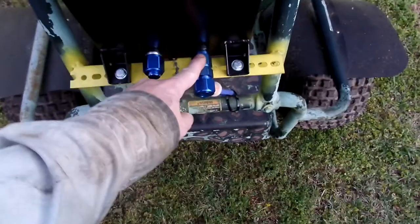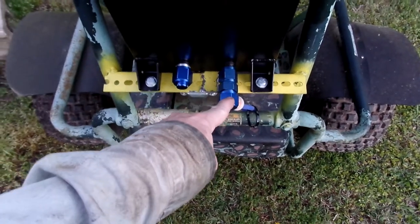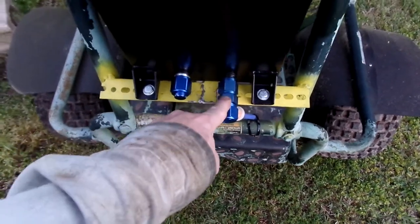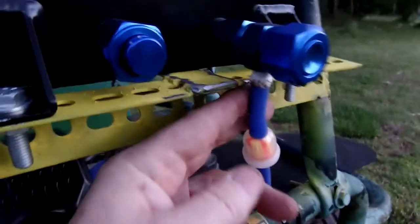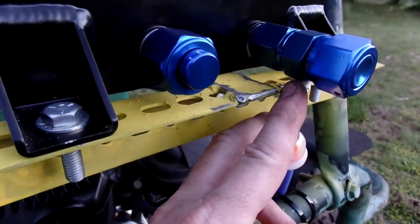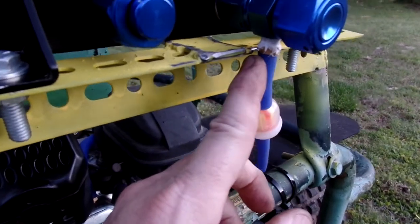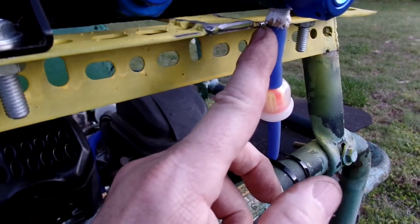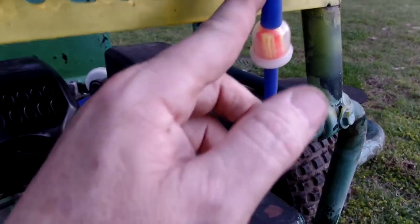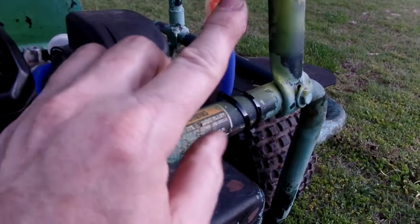This cap is not used. This is a dash-10 and a dash-10 end cap, and this is tapped for a 3/8 port — it's used for putting fuel gauges or a pressure gauge right there. I put a nipple in it — I can't remember the exact size, it's the one below 1/8.